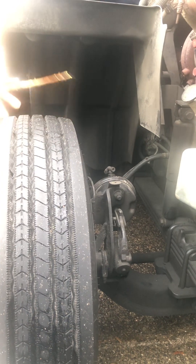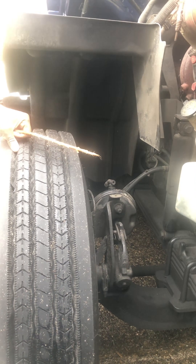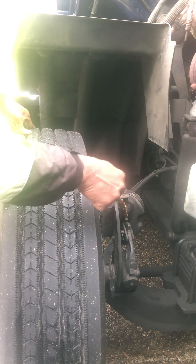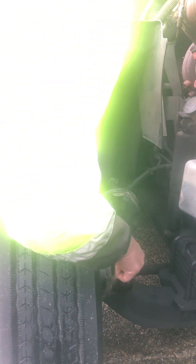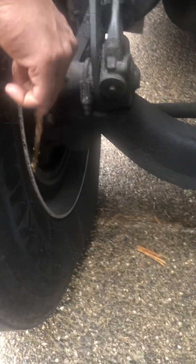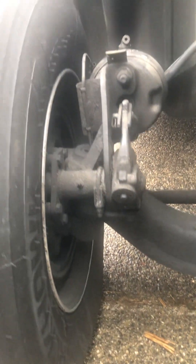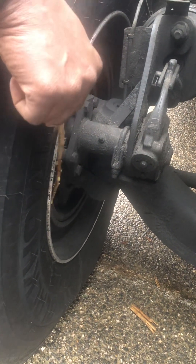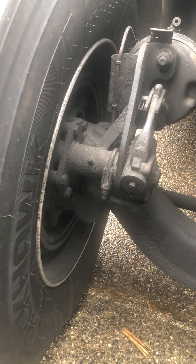That's my push rod and slack adjuster - mounted and secured to the vehicle, not bent, broken, or cracked. With the brakes applied, or when I use a glove and pull it very hard, it should not go more than one inch. If it's more than one inch, that means it's too slack for your brakes to function well. The push rod has a clevis on it. I'll check my brake drum - that's the brake drum inside here. Mounted and secured to the vehicle, not bent, broken, or cracked. There's also a brake pad - mounted and secured to the vehicle, not bent, broken, or cracked. There should be no oil, grease, or any contaminant between the brake drum and the brake pad.